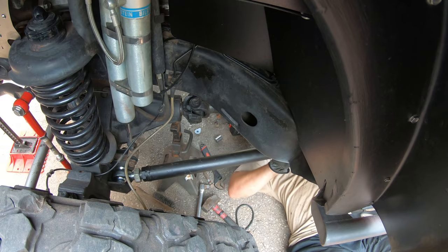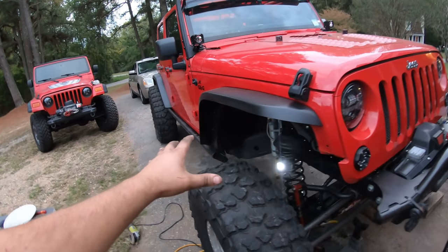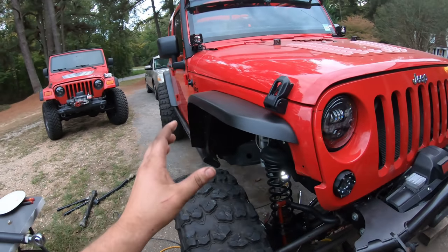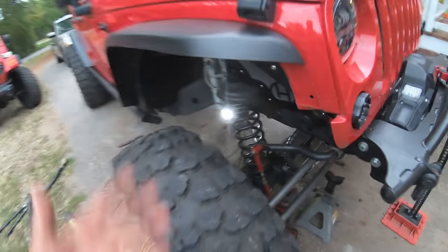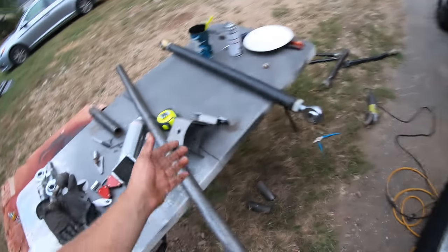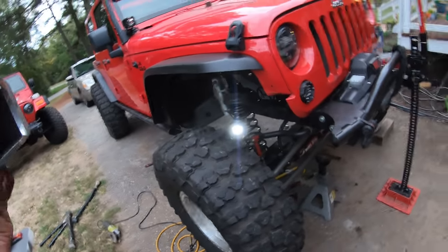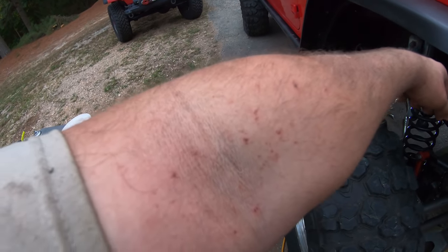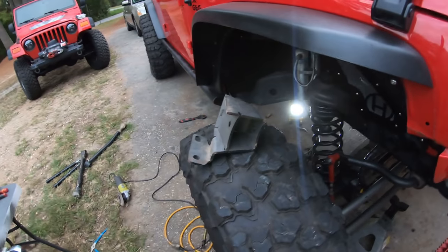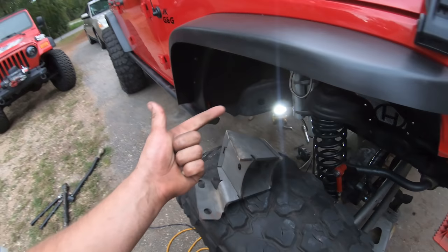Running out of daylight again. I've been clearing off the passenger-side control arm mounts and since the link is over on the passenger side, we have to remove the lower and upper mount brackets — got those cleaned up along with the axle truss. Our next steps are to prep for the upper control arm bracket. This job isn't hard, it's just not fun filming all this — down there with metal shavings everywhere, on my neck, face, and even in my eye. But trying to do the best to record all of this because sometimes videos are very helpful when deciding on a project or trying to follow along.